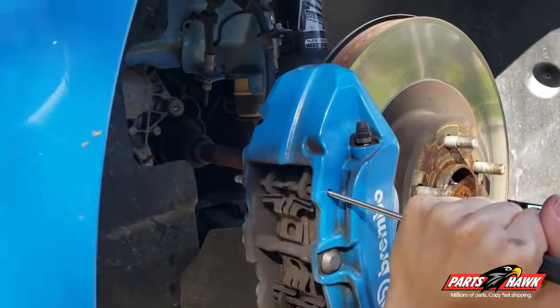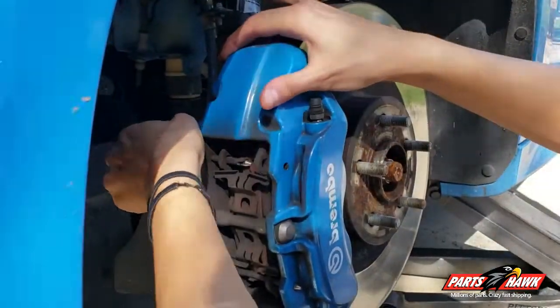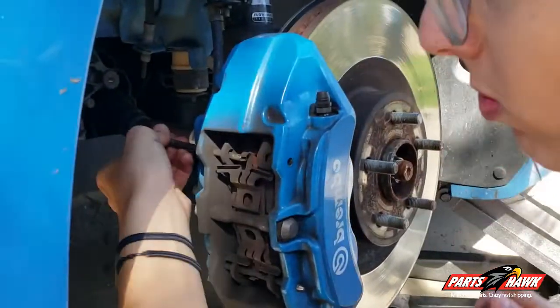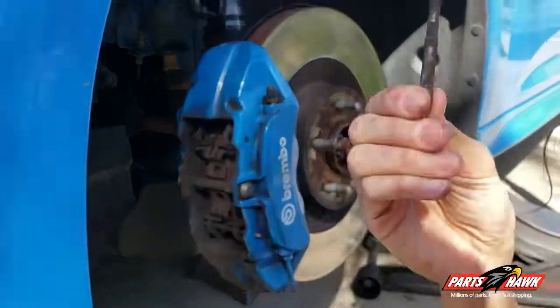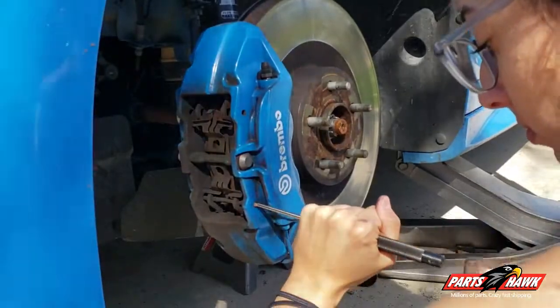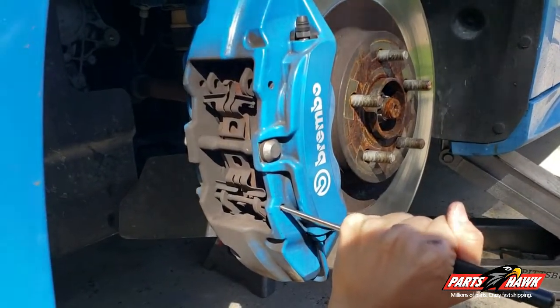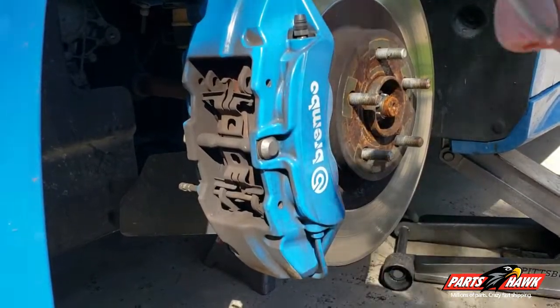Alright guys, so once you have the car jacked up and the front wheel removed, the first thing we're going to do is take our pin punch tool, which is going to be linked in the description below. You're going to take that and a hammer to the front face of your caliper and hammer it in to remove the pins from the rear.